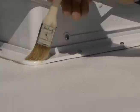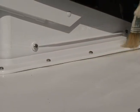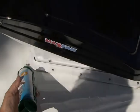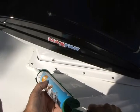If you are sealing plastic roof accessories like vents, vent caps or the refrigerator vent, be sure to apply the primer to those surfaces too. Allow the ultra-sealant primer to dry to the touch. Once it is dry, promptly use a standard caulking gun to apply a bead of Dicor sealant to the area being sealed.